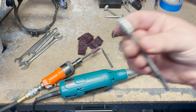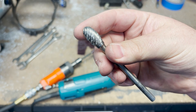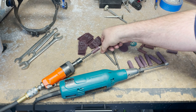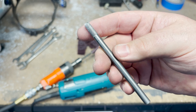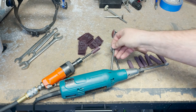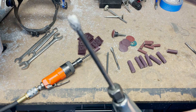I'm going to start off with the half-inch super spiral burr from Head Games Motorworks. I cut them down because I'm doing combustion chambers — I don't need to be six inches far on it, so we got four inches. Then I'm going to blend it in some of the tight spots with the Head Games deburr burr. This is going to let me get into some really tight spots that you can't get into with a bigger burr.